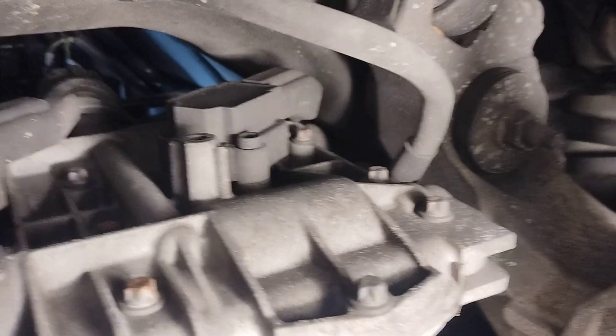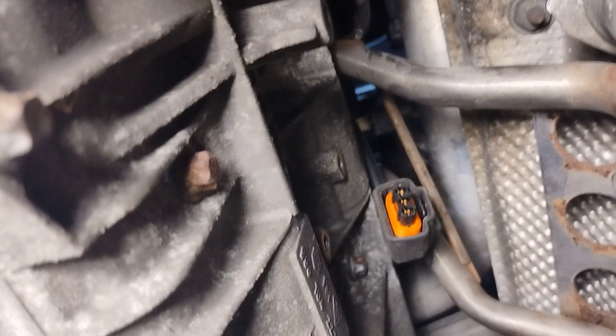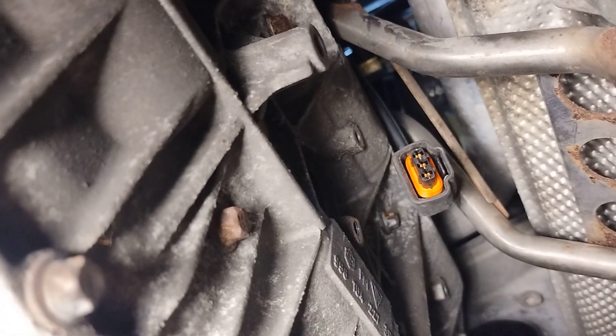When you get to the plugs, you'll look at them and go — where is the plug? Yes, that is just a cover and they do slide back. Once you get that cover off, you can use a pick tool. See how I slid this one back — it's really hard to get your hands up in there. That little thing above where the three prongs are, that's the release. I used my pick tool and lifted that and slid it right out.